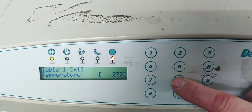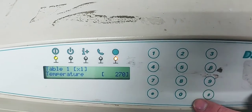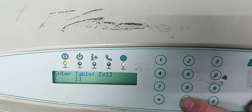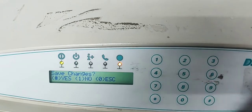Let's take it down 5 degrees. Whatever yours is displaying, take it down 5 — subtract 5 degrees. Then hit pound, and then we're going to hit 0, and then 0 again. That takes us up out of the menu.